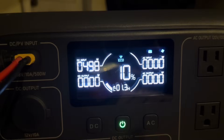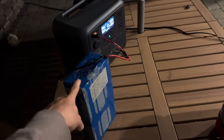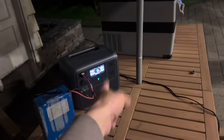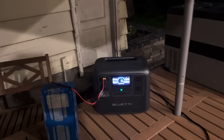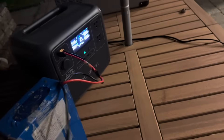It says it will fully charge the battery in 1.3 hours. The capacity of this e-bike battery is just over a kilowatt hour — it's a 48 volt, 20 amp hour battery, so it's about 960 watt hours. The Bluetti is 768 watt hours, so I will actually get a full charge from 0% on the Bluetti from this battery. Between these two, I have about 1.7 kilowatt hours, which will definitely boost my overlanding camping trips.